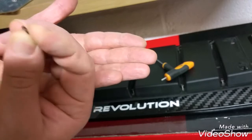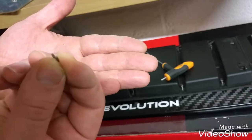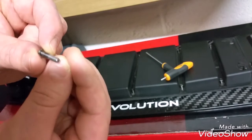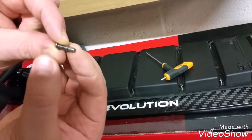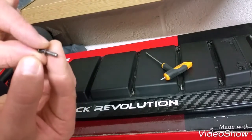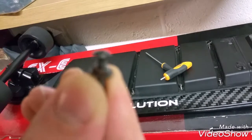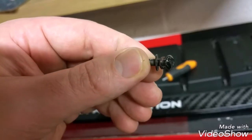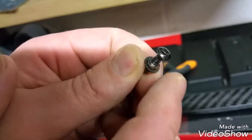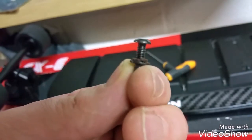Please note that each of the screws comes with a washer and also with a split jam washer. This is to stop your screws from unwinding when you are moving around from vibration. The way it goes back together is: screw, then the split washer or jam washer, and then a normal flat washer — flat washer, jam washer, and bolt, just like that.